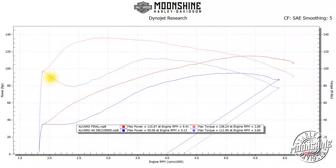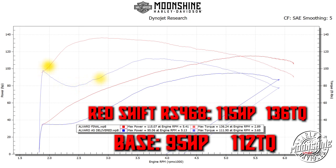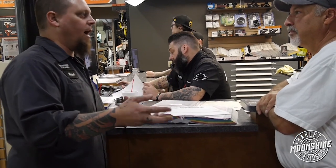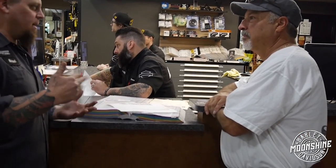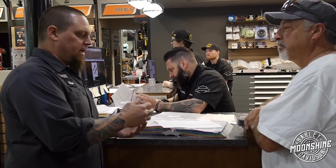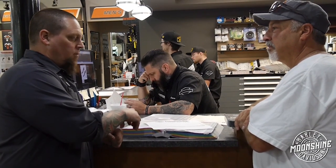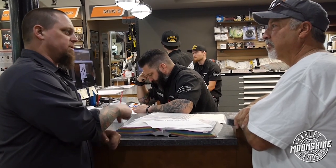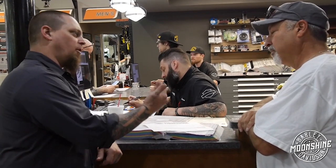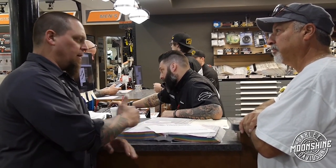The blue line is what it came in at. The red line is where it is now. What happens when you do these Harley Stage 4s — especially if you go the route your dealership went — they put the Harley Stage 4 on, you put a Harley tuner on it, then an auto tuner, then a high-flow exhaust. Well, the high-flow exhaust is not factored into the equation. When you put an auto tuner device and it's a closed loop system, it's still running on the original map. So the tune the bike had wasn't equipped to handle the exhaust to begin with. The auto tuner, when you're cruising it's fine, but as soon as you put it under a load it just dies. Because the tune it has to fall back on when it can't run closed loop is a hack from the tune.